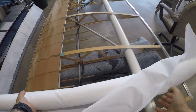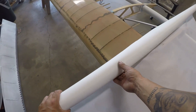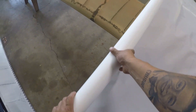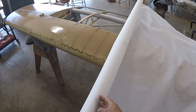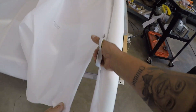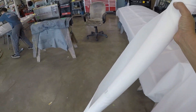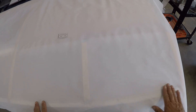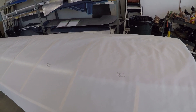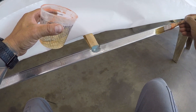Now you're going to take your fabric and unroll it. Usually I start to cover on the trailing edge just because you have a straight shot. The Kit Fox wing is pretty simple to cover — there's no real curves or anything like that. So you start on the trailing edge, apply the poly tack straight out of the can, and just do a section at a time because it dries pretty quick. You want to lay the glue down and then lay the fabric onto the wet glue.